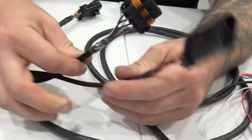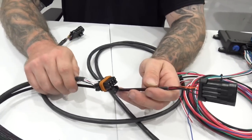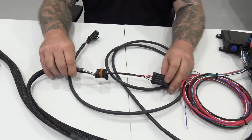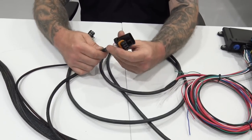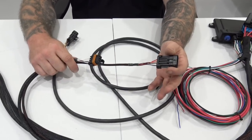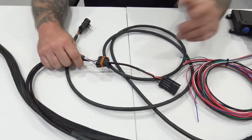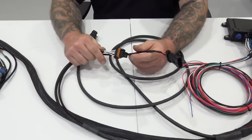So we kept the same connectors here because there are some other offerings from other manufacturers or other people that sell them that are good quality and plug into these things. The difference that we did is we set this up so that it would offset from each other. So if you plug the connector in here and plug the connector in here with the Holley harness, it's like this, and it looks like crap. So what we did is a simple fix, but it's just offset 6 inches from each other so that you can plug a connector in here. And by the time it reaches the backside of this connector, it's just wire, not any connector body, and then you can plug your connector in here. Made more sense. So this is your power tap and your input-output harness, okay?